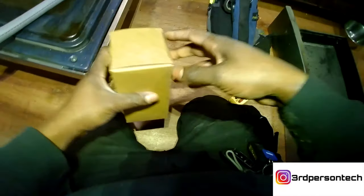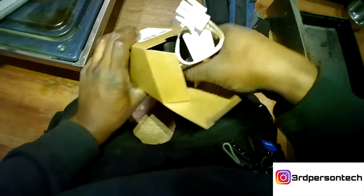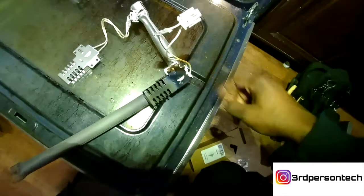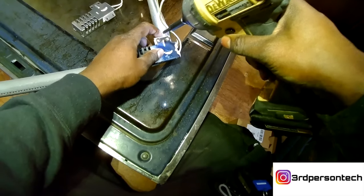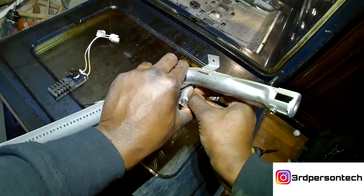Now that we have the burner out, we're gonna remove the igniter off the burner tube. As you can see, the igniter comes as a direct fit so we don't have to do any splicing — though you do have ceramic wire nuts in case you ever need to splice. The igniter is held down by a Phillips screw and what might be a slightly larger than quarter-inch nut at the back. You need to hold that nut at the back while you drive the screw out. Sometimes using your finger to hold it works, sometimes it doesn't — but it's working this time.